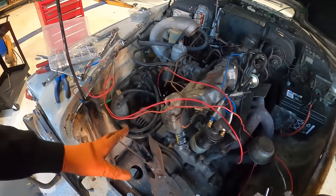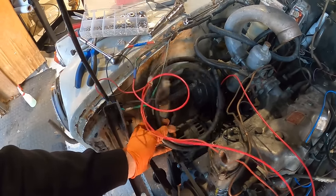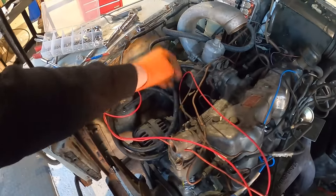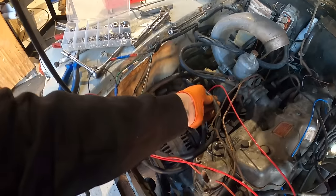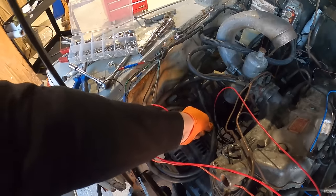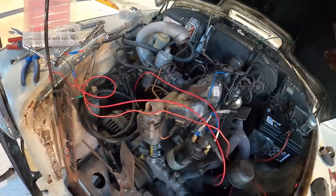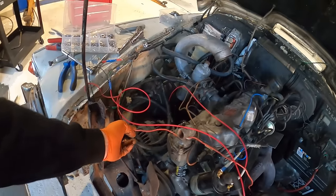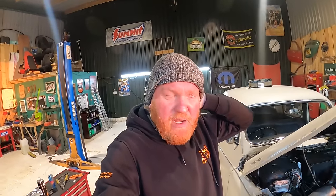One quite interesting thing I have just noticed as I'm about to get the radiator in is that this is a big coil of fuel pipe and it's just not needed. It goes from there to there, so it could just sit like that. So I'm just going to cut this off and put it on there with a nice little fuel pipe clip, which it should have on it, just to make things a little bit safer, because this could potentially rub all down here and on the belt and stuff, and fuel could leak out and everything could set on fire. So it's probably worth, for the sake of a 2-minute job, let's just tidy that up. There we go, that's much neater and frees up all this space down here as well. Plus, I get to keep that bit of hose for the parts department, because pennies make pounds, don't they? Got to remember that.